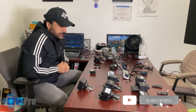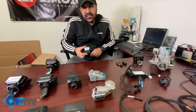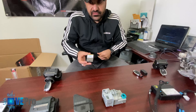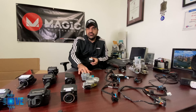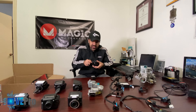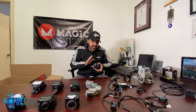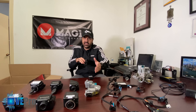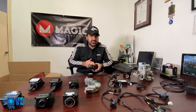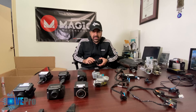This is pretty much an overview of the Mercedes system and we're going to go through each one. Whenever you insert the key into the Electronic Ignition Switch, the EIS checks if the key is authorized. It checks the serial number, the SSID, and everything else. Once it gets the green light, it sends a signal to the steering lock saying it has the right key. The steering lock unlocks and sends a signal back to the EIS, which then commands the engine computer to fire the igniters and injectors to get the car running.